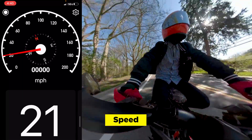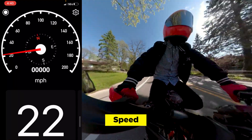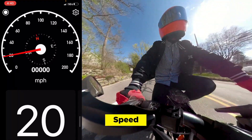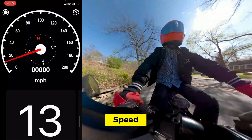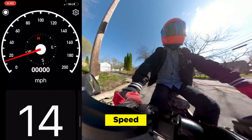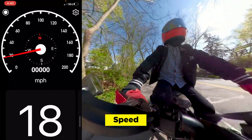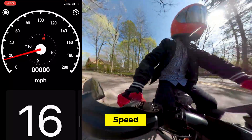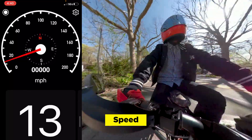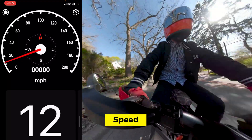One thing to remember is that riding full throttle can overheat the controller, which is why a lot of people recommend mounting the controller outside so that the wind cools it down as you're picking up speed. Going up this hill, I am noticing some slight cutoffs. The controller is really hot and it is giving me these small cutoffs that I'm able to regain my throttle after I let it go for a bit. It hasn't completely shut off, but it is cutting off here and there. So that's one thing I'll definitely have to do — mount the controller on the outside.